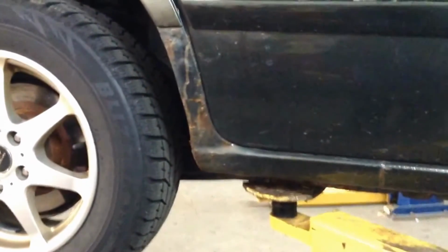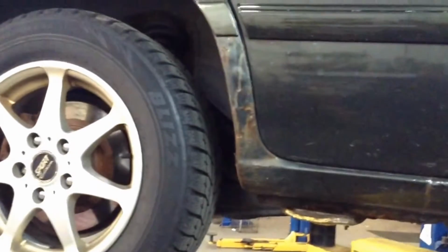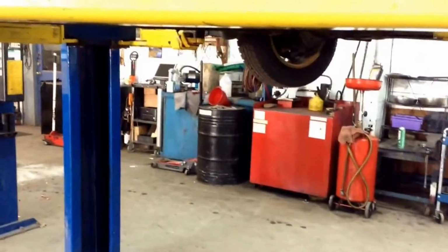Oh man. Now this guy went and had this car painted less than a year ago, last spring I think it was. And you know, they sanded the car and filled spots and painted it. Look at all the blisters coming back out. That's because the body shop he went to didn't use the phosphoric acid. If you guys look back a couple of videos, you'll see that stopping rust cold video. If they had done that and treated this correctly, that wouldn't have bled through there and blistered there. That's because there were little blisters and they opened them up to more oxygen by taking the paint off, and the result of that was more rust on your new paint job, which, you know, oh well.